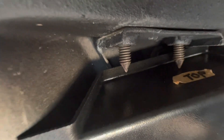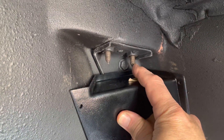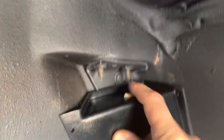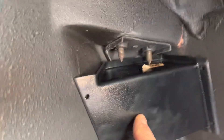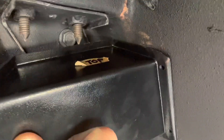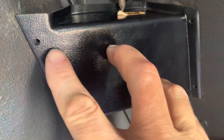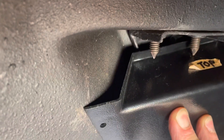I'm not sure - there's a pretty big gap over on this side so I'm not sure if that's fitting properly. These bolts for the hood hinge might be a little too long. They obviously don't need to be this long, so maybe I've got the wrong bolts, although I'm pretty sure these are the originals. There's about a half inch gap on the back side - this side fits okay, pretty flush. But these holes don't really line up with the angle. Maybe I need to heat this edge up and push it in so it flattens out and gets the right angle.